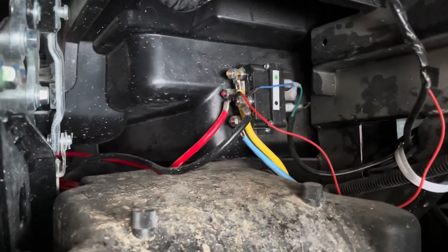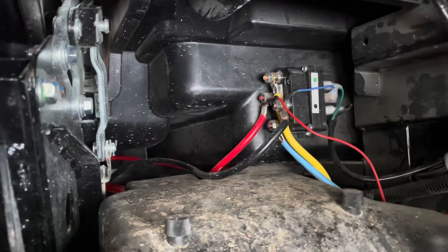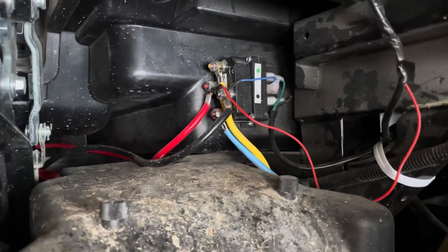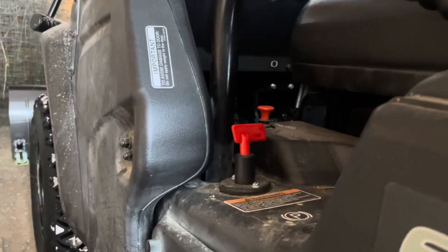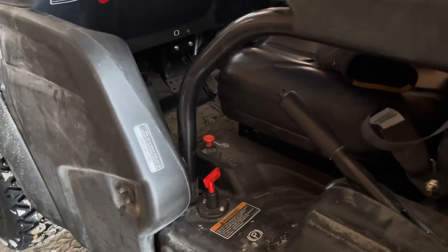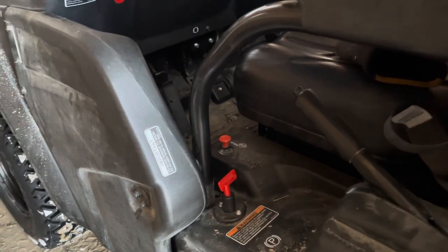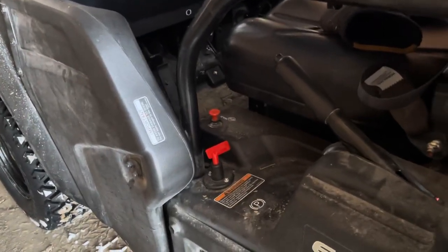I did not wire this straight to the battery, nor did I wire it straight to the ignition like the instructions said. After doing some research on my own, I decided to go a different way. What I did is wired the power right to a kill switch, and then wired it from the kill switch to the battery. That way I just cut the power to the winch when I'm not using it — don't want to worry about any dead batteries. I just switch this on or off, works pretty awesome. That's how I wired it up.